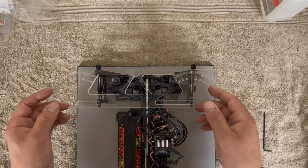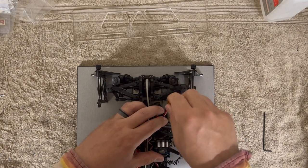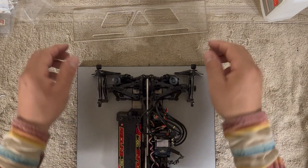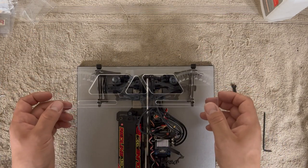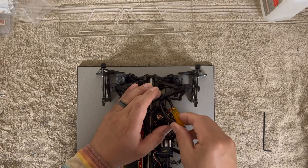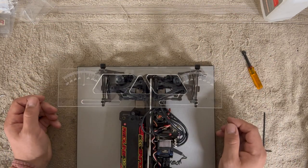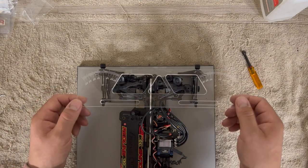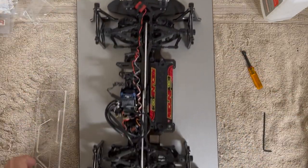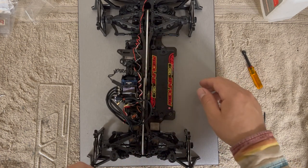I'm back at four. Continuing adjustments — not quite a full turn. A little too far, bring it back. Almost at three. Perfect — that's three. Going back to verify camber: still at two. Everything still at two. Now for the front toe, which gets a little tricky.